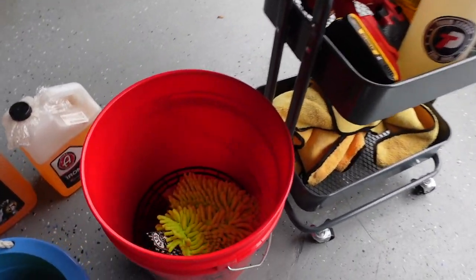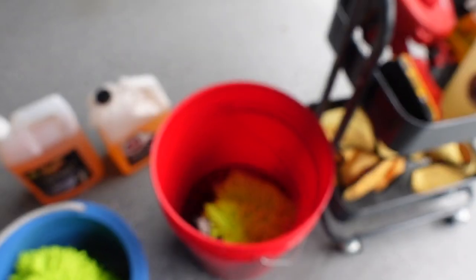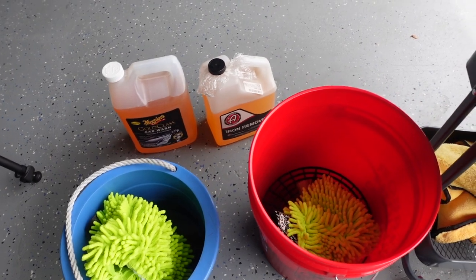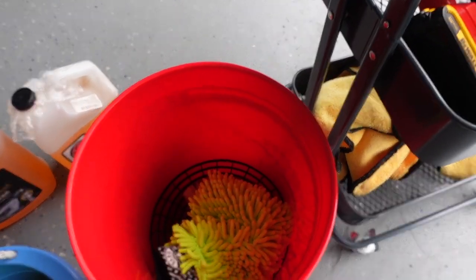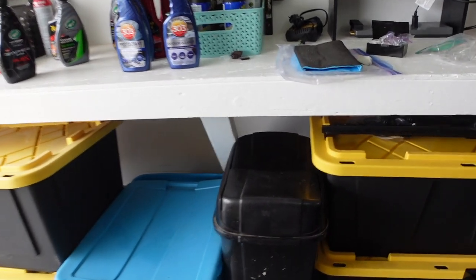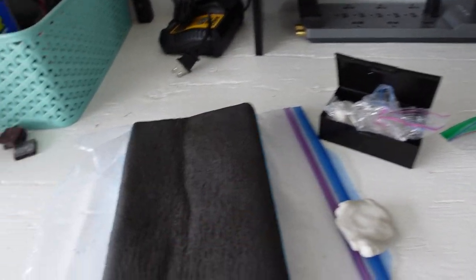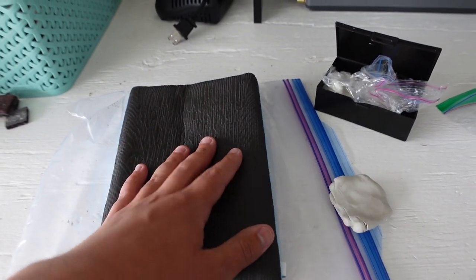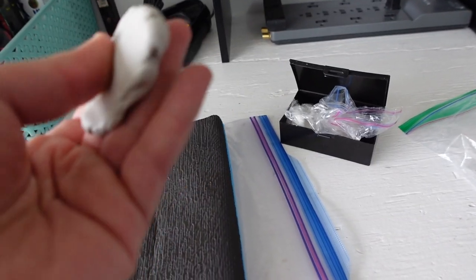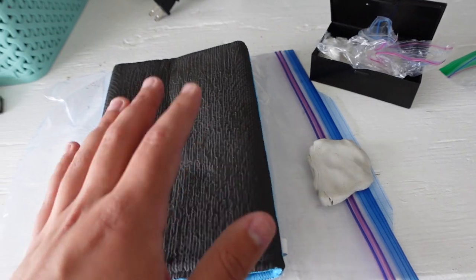This whole area smells like it. I use a blower just for blowing off any water. I use one bucket for the car and one bucket for the wheels — I do put a little bit of soap in them but I don't do the two-bucket method anymore because with the foam cannon it's not really as useful. I also have a small detail brush. Because we're taking off contaminants, I want to show you guys a clay bar — a lot of people like to use this — however, since there aren't many contaminants on the truck, I'm going to use a clay mitt instead.